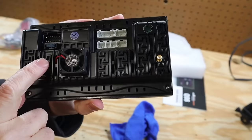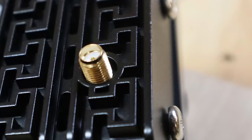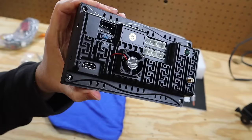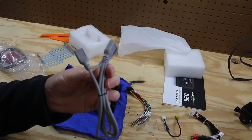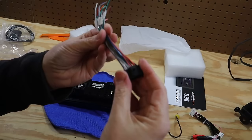On the back you've got a plug for your standard car audio wiring harness, a 15-amp fuse, plus a full-sized HDMI port. There's a fan and a spot for both an FM antenna and a GPS antenna. That double row of white plugs is for the bag of goodies — in that bag there's another USB port, the GPS antenna, and a standard harness with power and speaker connections.